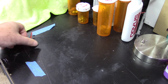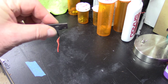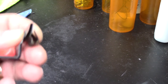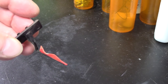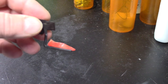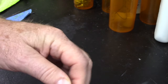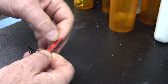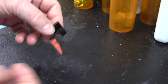So what I'm getting ready to do now is — I told you guys this pointer was warped. You probably couldn't see before how warped it actually was, but if you take a look there, it's pretty warped. So I'm going to try and take it out of here, heat it, and flatten it, then paint it and stick it back in. Let me get my heat gun and see if we can get this thing out of here. It should just pull out maybe — kind of crimped in there. It's probably crimped and glued, so it might not come out. Let me just get my heat gun and see if I can heat it up and mash it flat.